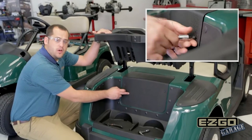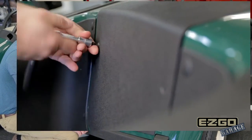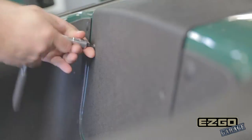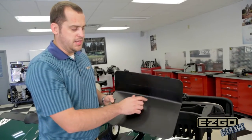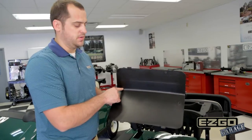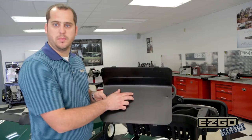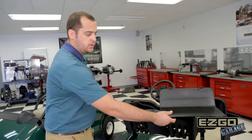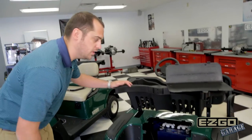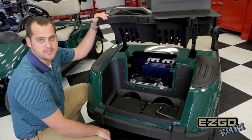When installing this accessory or working with any tools, we always want to remember to wear our proper safety equipment. We also want to uninstall the motor access panel by removing the two screws that hold it in place. Now, I want to bring your attention to these preformed X's on the backside of the panel. We want to drill out these lower two with a 7/16th drill bit, and these upper two with a 9/32nds. We also want to go ahead and install the speed clips that are included with this hardware kit on the body tabs behind the access panel.